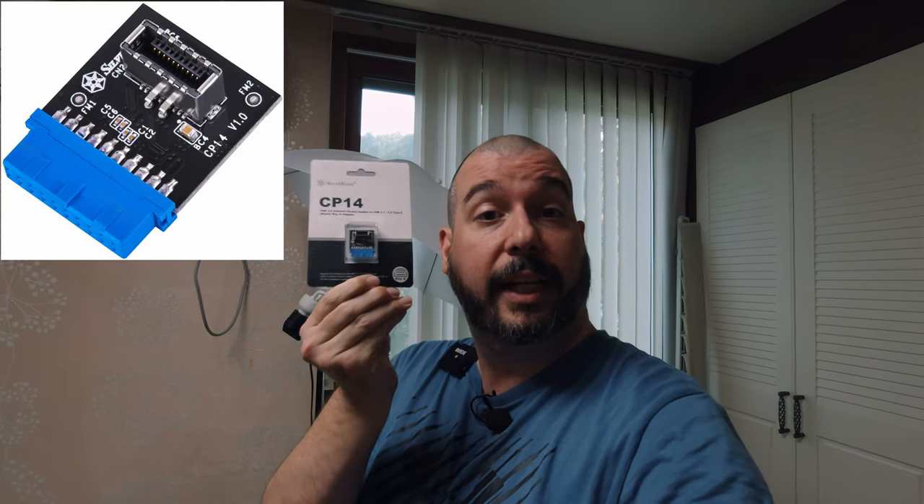All right everybody, this was going to start out as a quick little thing on the adapters I'm really liking from this build. So this one right here — which is a thing I did not know existed — is because the case I bought has two front USB Type-C ports, but I did not find out until assembling it that the motherboard only had one port for the USB 3.1/3.2 header. So this adapter converts that front panel USB 3.1/3.2 to a 3.0. That does mean you'll be limited to 3.0 speeds, but it means I'll have two Type-C ports active on the front, as opposed to having one running full speed and one that doesn't run at all.